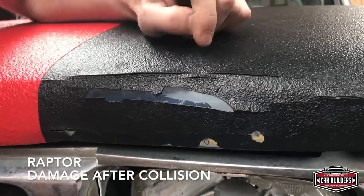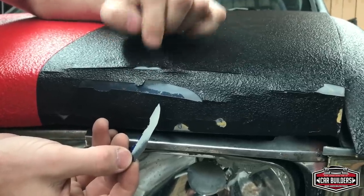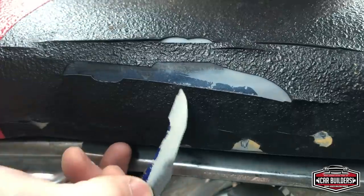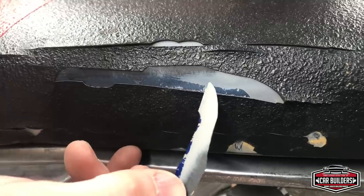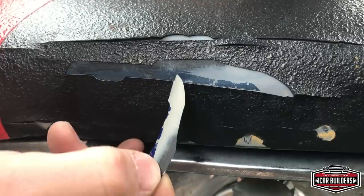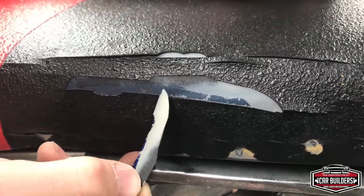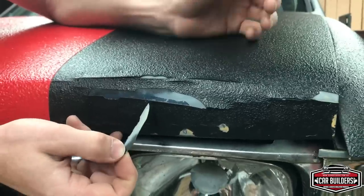You can see where we remodelled the front end of the truck. There's definitely an adhesion issue here — not with the Raptor. The original colour was blue, someone put a primer over the top without prepping or sanding it well enough, which means everything else is going to delaminate as soon as you get some flexion. Sanding is the key. The paint's going to hold on as good as you prep it — always get rid of the gloss and shine, and when you've done that, you're ready to paint.